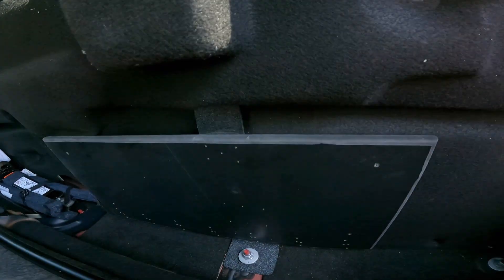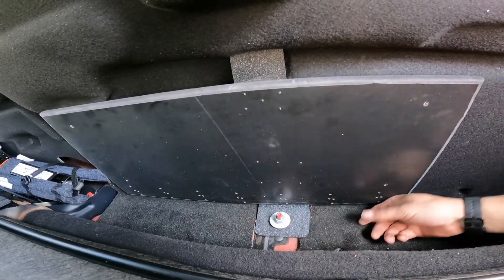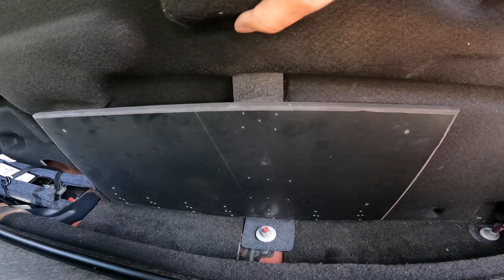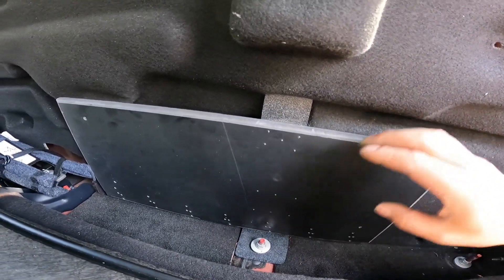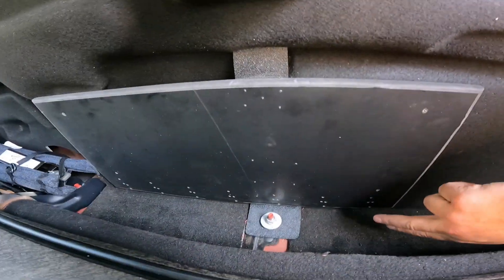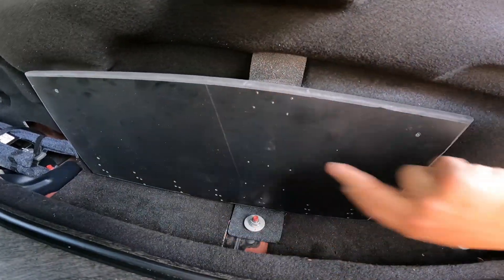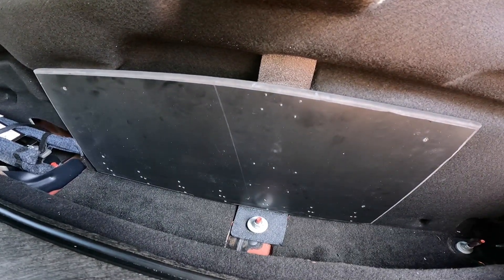As you saw earlier, we're getting ready to make the amp rack for this SCAR Audio amp. Now we have it in place. You can see I've got it bolted right here — that keeps the bottom secure. We've got a tab here that goes up to the seat bolt here, bolted in behind that. So this is not going anywhere — nice and solid. The amp's going to mount here, and all these holes on the bottom are drilled for zip ties so we can run the power and ground this way.